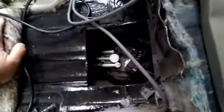And now we're ready to continue to do the rest. The next thing is going to be to pop up the fuel hoses. As you can see, it has this clip in which you push it on both sides, and then that thing will pop out. Okay. There is some fuel that is going to come out, that's for sure. But let's try it.